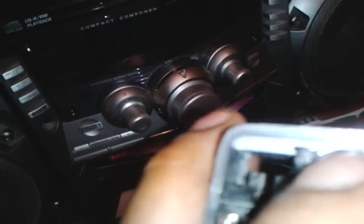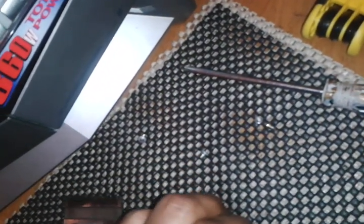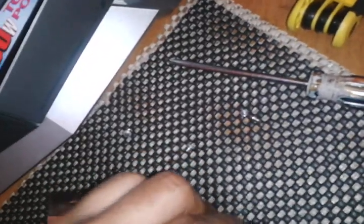And that's because these two prongs, these two little forks, from wear and tear from where you've been running your clippers for a while, sometimes the vibration will cause them to close in. What you want to do is take a flat-headed screwdriver, stick it in the middle of them, and bend them back out. You can go this way or that way. When you do that, it'll cause this to snap into place. If I can get that back in with one hand. You want the cutter blade in snug and tight. I can't get it with one hand, but that could cause a lot of vibration and clatter as well.